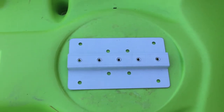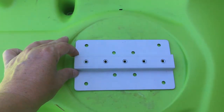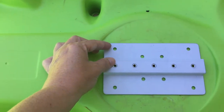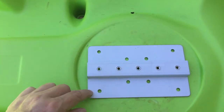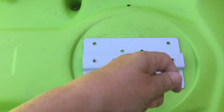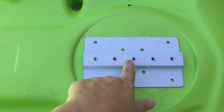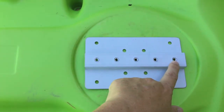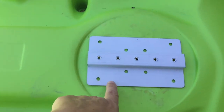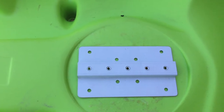When you get your order, you'll get the whole Angle Oar system, and included will be this stainless steel mount setup. The first thing you'll want to do is peel back the film on top — it's actually just a film that pulls off to reveal a brushed stainless steel surface. There are five threaded holes in the middle that secure to the track holding the Angle Oar system, and then there are eight holes you'll use to secure screws right into the kayak itself.